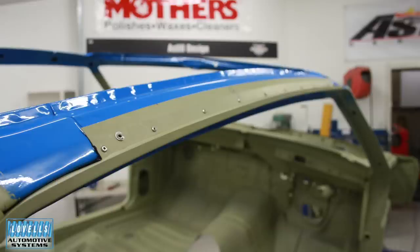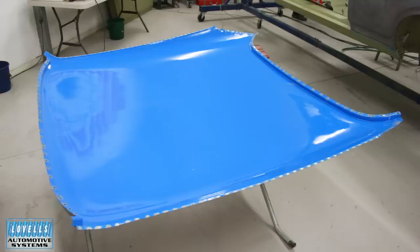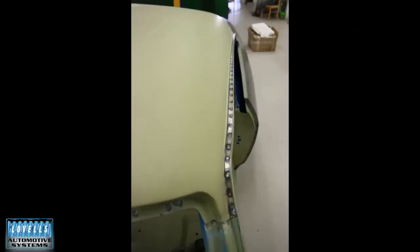There's that nice straight roof. The philosophy here was that we knew Darren wanted to put a sunroof in, so my thinking was to make the roof really nice so when we go to put the hole in, we know it was good to start and should be able to get it back to good. If it's already dented and you cut it, you've got an issue. Secretly I was hoping he wouldn't put the sunroof in. I'm not a sunroof person but Darren clearly is and it's a personal choice — it's just a waste of good roof. All the crosses measured out, wire-wheeled, all in place, lots of clamps.